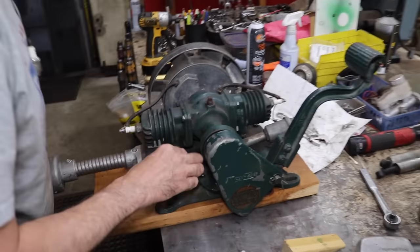The fuel tank is leaking that gasket on there. So let me get something and take this bolt out of the bottom here. That may have something to do with the jetting of it. And I'll throw a new set of plugs in it, and then we'll go from there. Let me find a socket. Looks like it's half inch, 9/16, half inch. Looks like a bunch of crap up in there.